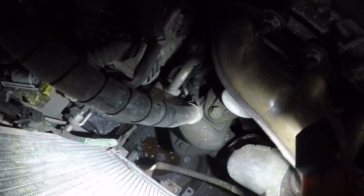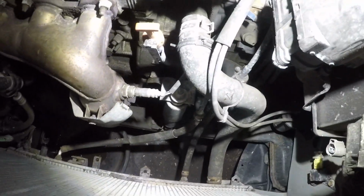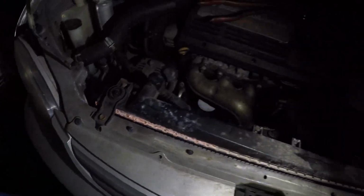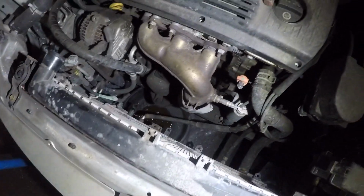And after that, we'll remove the two transmission lines. All right, right there. And then we got this connector. Oh, I'm sorry, I thought it went to the AC compressor, but this connector goes to the sensor inside the radiator. And then we're gonna remove the two transmission lines on the side, and the radiator lower hose from right here, we remove it from the neck, and then we're gonna have to remove the mount here and mount there, and the radiator's out, guys. So let's give it a good half an hour for it to drain out.